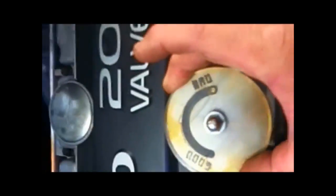This car here, I don't think it's going to have very good pressure. Let's see. Yeah, it's in the bad already — that's just at idle. Go ahead and give it some boost. See the ball? Yeah, the ball stayed in the bad. It's got high crankcase pressure. That's what we're looking at.